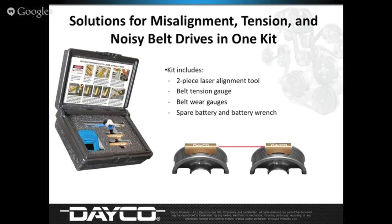Not all pulleys will be a clear line of sight from the crank pulley. If you have verified another drive pulley is in line, you can use that as a base for those you can't reach with the harmonic balancer — absolutely, in most cases you'll have to do that. You start at the crankshaft and work your way around. Every pulley that seems to be in line, you can anchor the laser to that, and use deductive reasoning to figure out where the misalignment occurs. These belt drives are not simple — you can't just spin them around to every component.